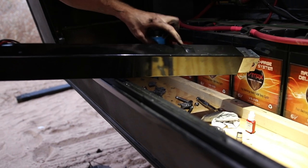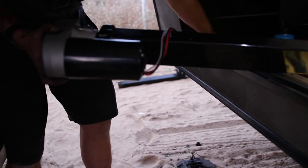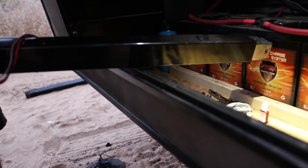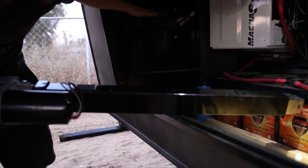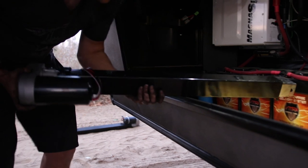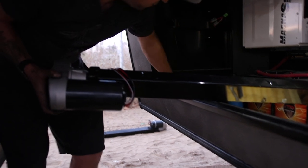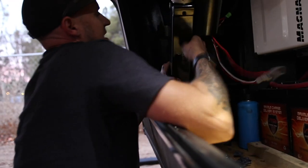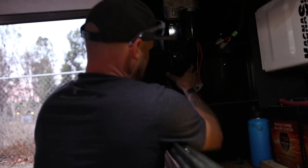These jacks have two little humps that fit into the sheet metal — they hold the jack in place while you connect the main brackets. One hump sits on top of the bracket, the other sits right underneath. This helps share some of the load as the coach presses into the jack, though the real heavy lifting is done by the carriage bolts. Slide the jack in so those two humps fit below and above the two main brackets, then set it up using your super strong dad strength.